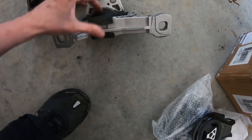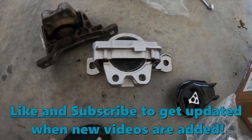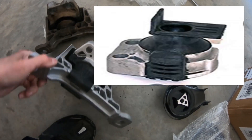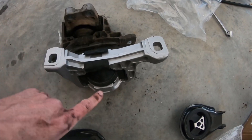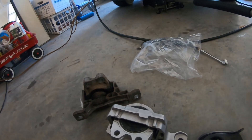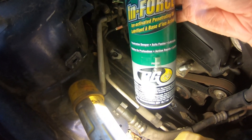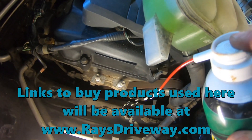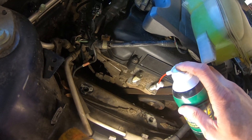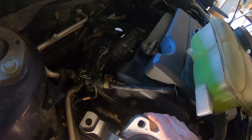This is our new mount. You can see how stiff it is — there's no break here, it's brand new. These are the other engine mounts that we'll be doing in the next couple of videos. You can also get this center insert for the mount separately. Generally all you have to do if you buy it and it doesn't come with the bracket is slip it into place and bend one of these tabs over either in a vise or with a pair of pliers. Before I slip the mount into place I'm going to use some rust treatment — I like BG products, this is BG Enforce — to lubricate the holes and the studs so that our bolts go on nice and smooth and won't seize easily should we ever have to remove it again. Then we're going to slide our mount down into place.